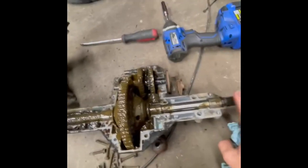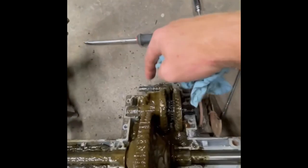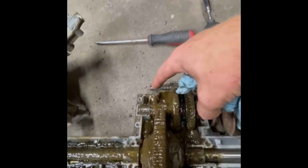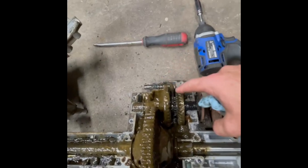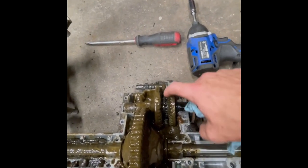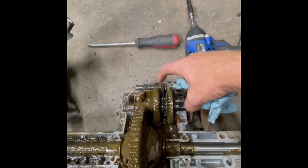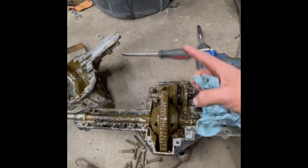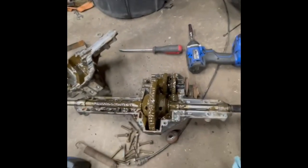I'm going to get a sprocket, chain, and sprocket setup put in on this new axle, and there's going to be another one on the other side. I have to get a new one because this gear is actually machined onto the shaft. This is my shifter lever — when it's in the middle it's in neutral — so I'll be able to retain all that. But now this will be chain driven and it'll be a solid axle that's wide enough for this go-kart.